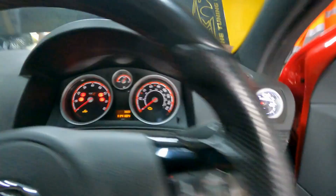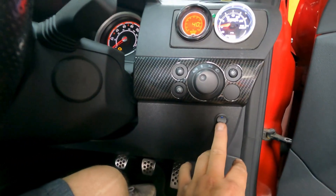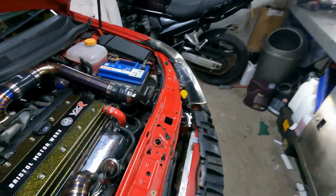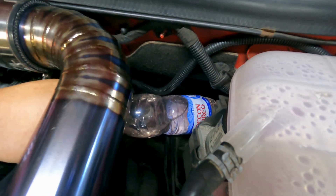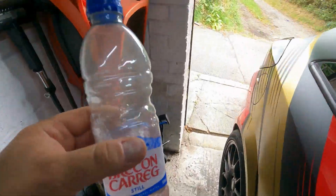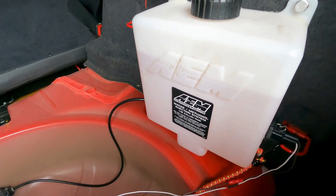The purge system has been wired to ignition, so the methanol is now live. I'm going to press the test button — as you can see the lights are coming on. We've hidden the controller in here which is nice. Press and hold the test button — you can hear it purging, it's spraying. The test runs for a few seconds then shuts off. We're starting to get meth through to the front. I've purged off a good liter or so, so we're definitely on meth with the system now — ready for the remap tomorrow.